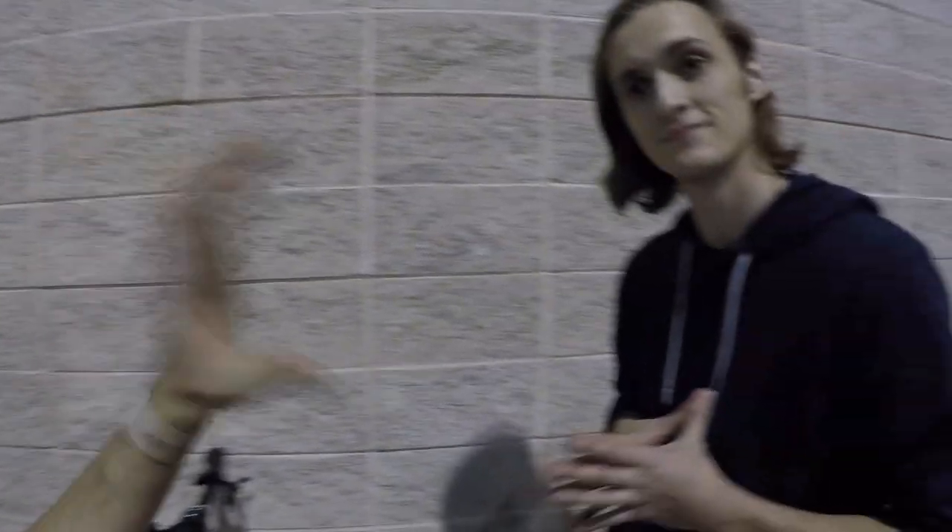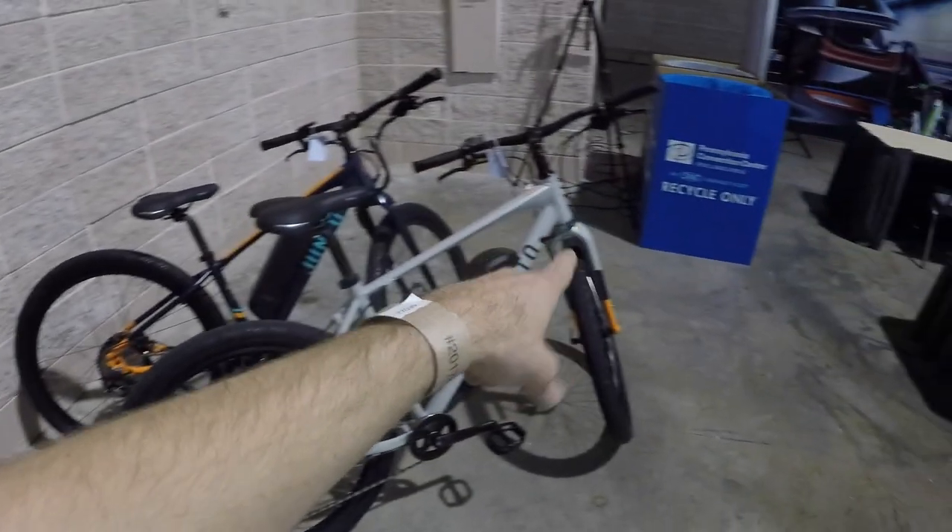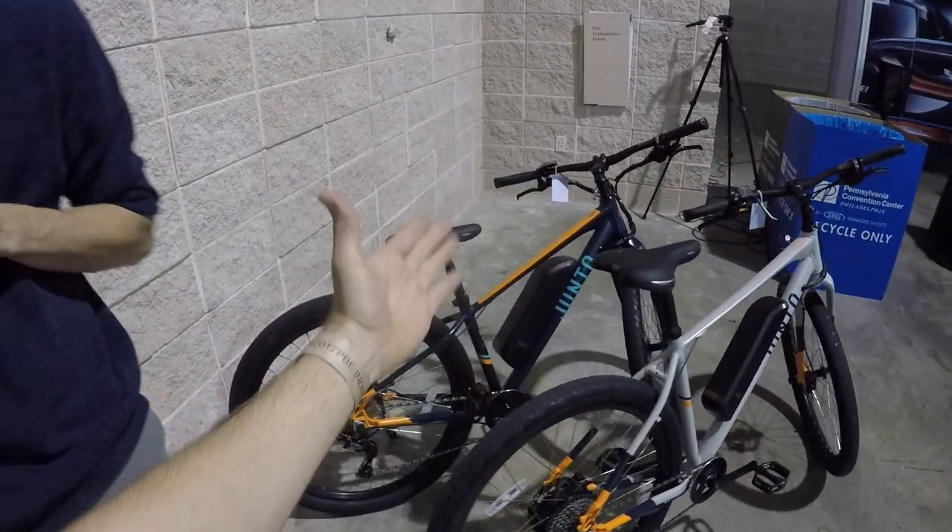That front-weighted position gives a tougher, confident feeling — good when navigating traffic and tight situations. It really helps you take your lane. Regarding the unsprung weight in the back, hub drive really belongs on a hardtail bicycle, at least that's how they feel. They accounted for suspension with the plush tires on this bike — you can gain efficiency by keeping the bike rigid and dialing in tire pressure to your weight and ride preferences. It's rated 40 to 65 PSI. As a lighter rider at 135 pounds, I'd bring the pressure down for comfort, and it'll still be compliant and fast because it's rigid. The fork is paint-matched — you can see that on the gray colorway too. The small only comes in blue, medium in gray or blue, and the large 19 comes in just gray.